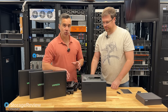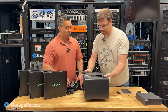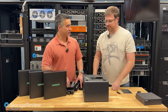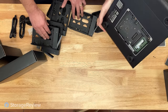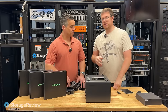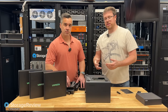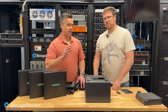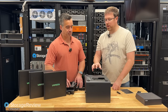While we're here talking about storage, the OS itself — in some NASes that installs across the hard drives, but this one has a separate OS SSD, a 128GB SSD. We found it — it's right there, tucked in the side. It looks like it's either SATA or another NVMe M.2. They use that for onboard storage, which can give you faster boot times. I kind of like the idea of a dedicated SSD for OS, just like a server or any other PC. It also means you could probably deploy the same without internet access.